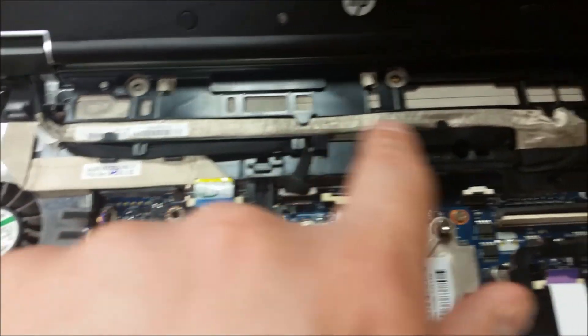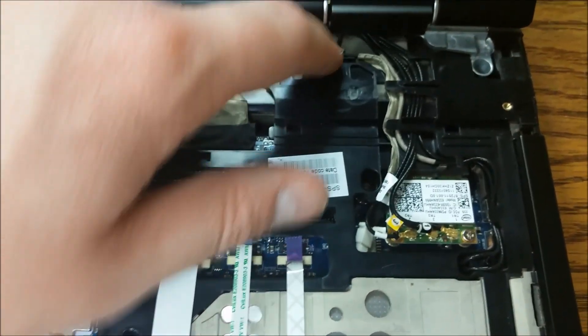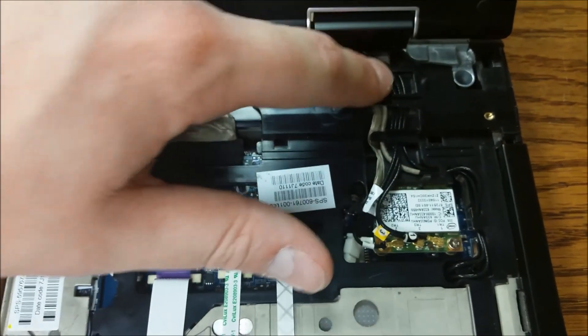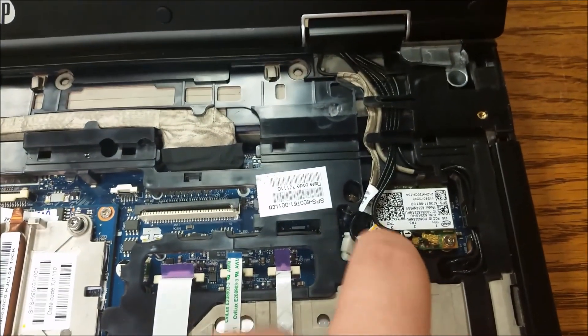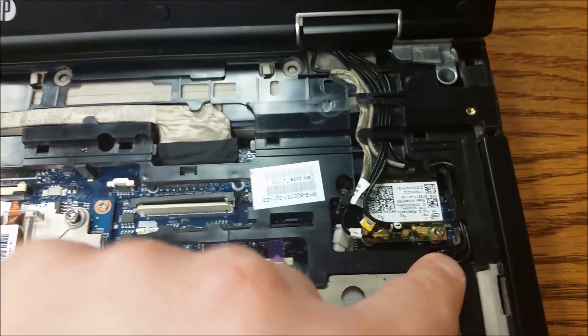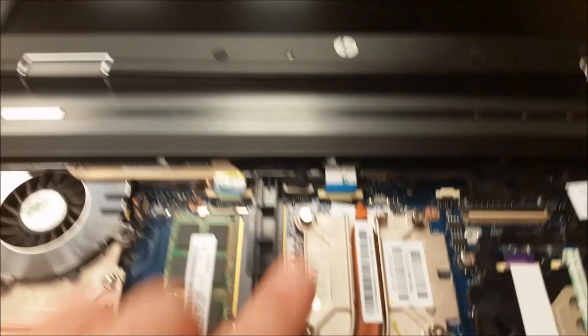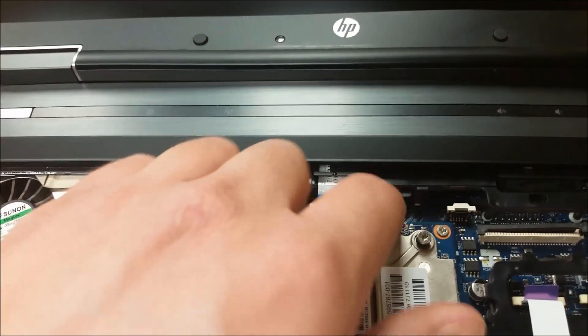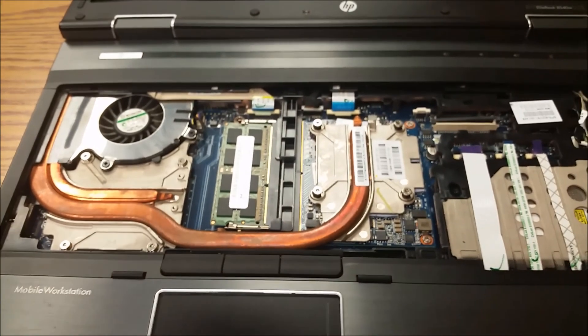And put the keyboard back on — we're almost done. We had this cable here that fits nice in the tracks. Make sure you get those tracks — plugs right in there. You've got six antennas, or rather five antenna wires and then the microphone. Run the wires the same way they were. If you get one overlapped, it's not going to really make a difference — there's plenty of room here. These are numbered on both the card and the wires, which is nice, so just pop them back on. Remember we had to push the other two through that hole so they come out the back of the laptop. Switch cover pops right back on — this basically installs itself. That clips back on, and good news: we have no more screws on the top, all of it's in the bottom.